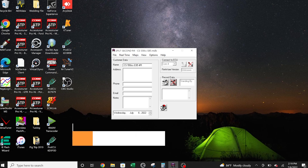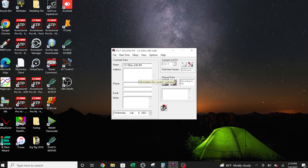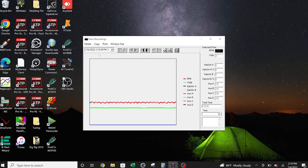To record a log in the split-second controller, you just click this button here — Start Capture — and it's going to record. Just let it run. You're going to want a nice long serial-to-USB cable so that you can reach from the split-second controller in the engine bay all the way into the cabin, so you can take a log on the street. After you've done your log, just hit Stop Capture, then click View, View Recordings, and you can see the recording you just made. At idle you won't see any injector pulse, but when you go full throttle and the injectors are coming in, you should see the injector pulse width lines populate. If it's not working, you may not see that, so that's something you'd want to address. But you're probably not going to have to do this unless I specifically tell you to.